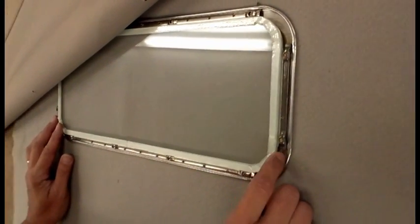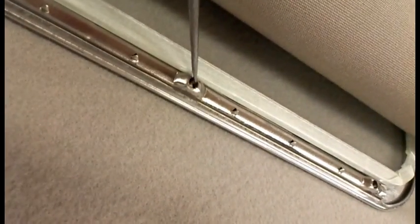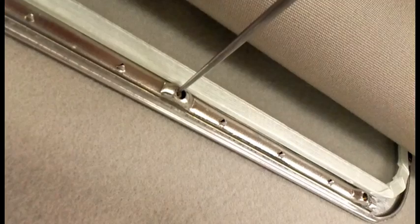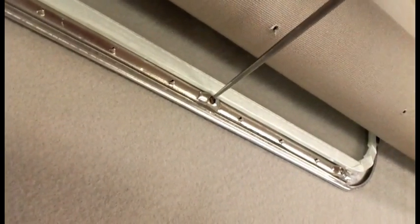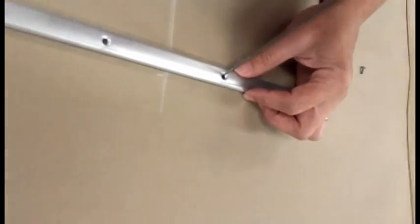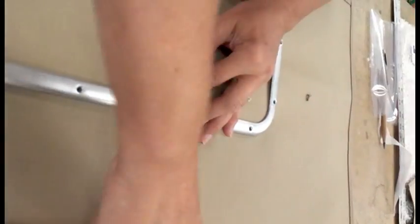hockey stick wrapping tape. So in each of the sockets that you're screwing into, there's a thread in there that moves around. So it's best to take a peek and get those on center so you can slide them off to the side. You want to get those right in center before you lay your fabric over. And then our fabric is lined up. Use a scratch awl to line all those parts up before you try to put your screw in.